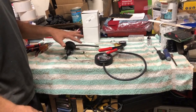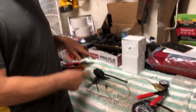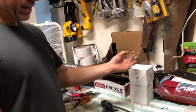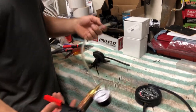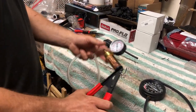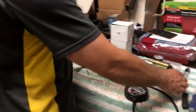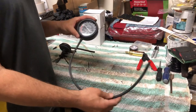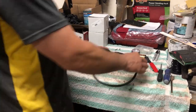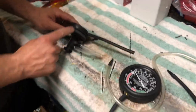I'm going to show you how to test the relay. I know my relays are bad, but I'll show you how to test it. You're going to need two tools: a way to create vacuum — I'm using a brake bleeder and vacuum pump kit from Harbor Freight, very cheap — and then a vacuum gauge. This one off Amazon was about $17.